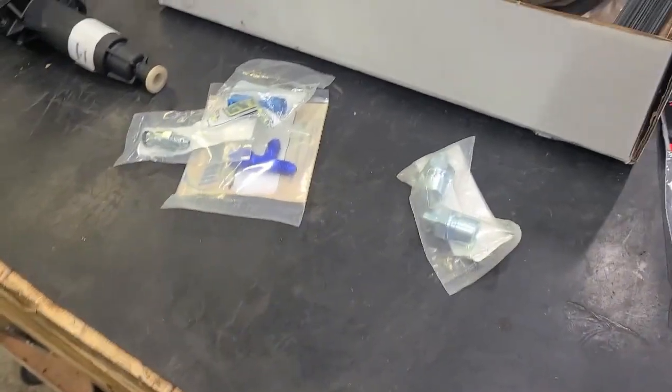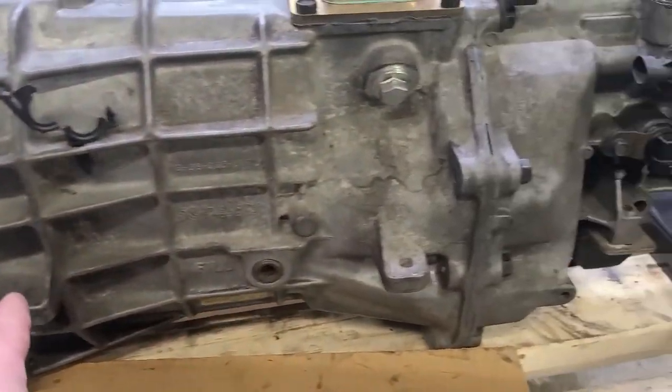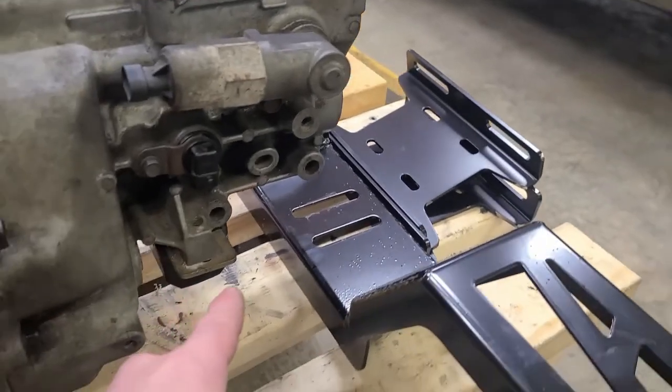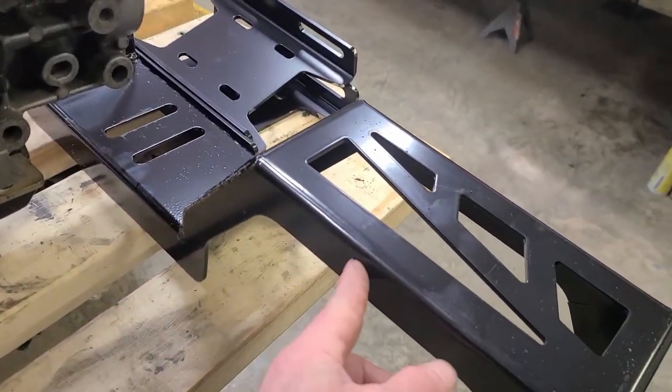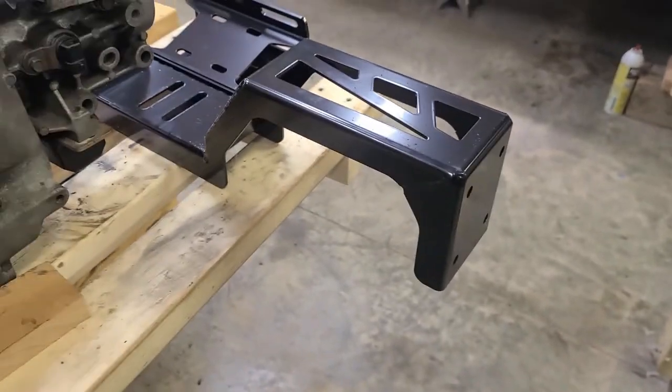So I'm going to come down the transmission. So the clutch goes here, comes out. We come down with the flex line, curve in, and I'm going to mount the hard line here, come across and up the frame.